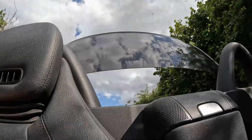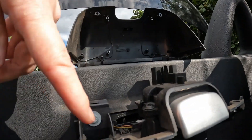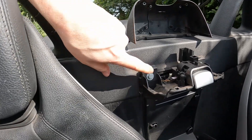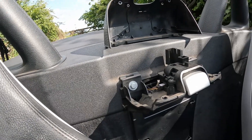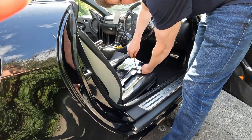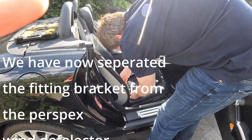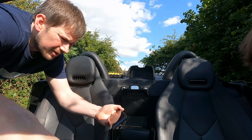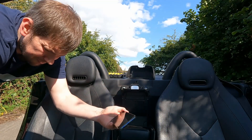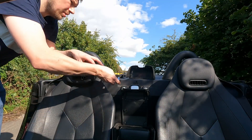So what you need is a TX-20, one of these torque things. When you open this up, just underneath here are two very small screws that once you've taken off you have access to this. The next stage is just to loosen these off going off the instructions. Following these instructions on YouTube — you will see two 10mm silver coloured bolts. Unscrew those and that will let you attach the stainless steel support bracket.